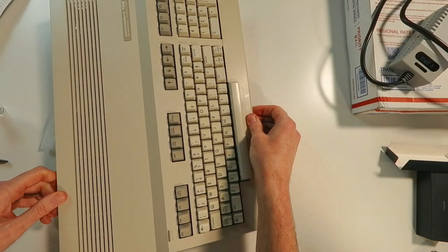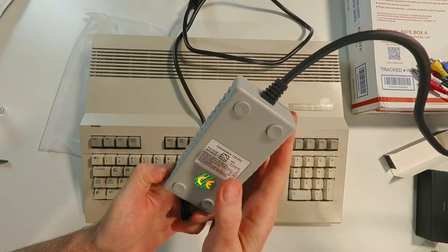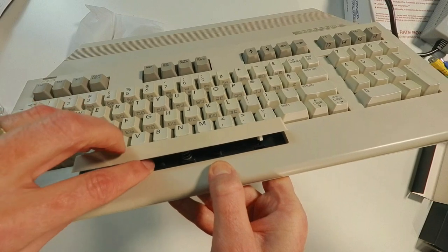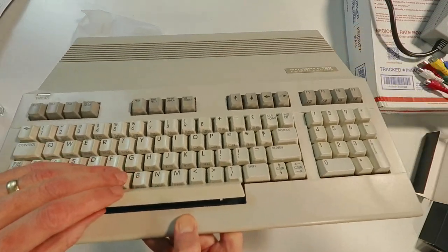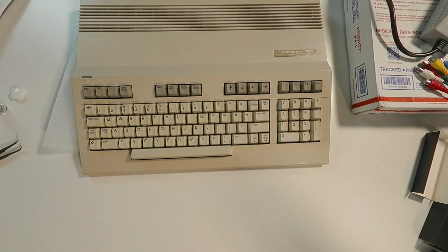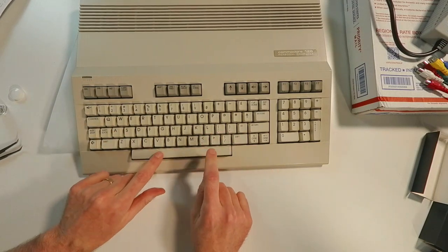This power supply — I love this little Commodore 128 power supply, it's a third party. I'll link to that in the video description. The big question is: when I press the power, will the power light come on? There we go — now it's working again! It just turned out the connector was one pin over and wasn't working. Now let's see if we can get that space bar working. There are two little holders for the springs, and what happened is underneath there are little catches that did not seat with those springs. Now we're cooking with gas — if I've done this right, I should be able to press it and we are back in business!